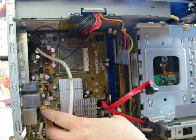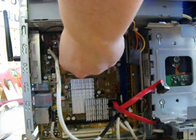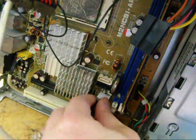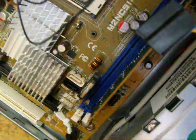Now we're going to have to unhook all the connectors. You've got the power supply connector here on the top part. You've got the data connectors that need to be taken out for the hard drive, the USB front bus — all those need to be unconnected, just pulled out — and audio here. That should take care of all the connectors.